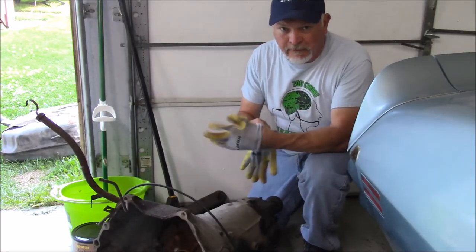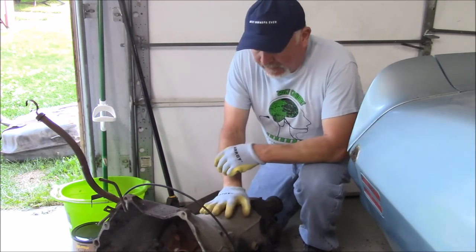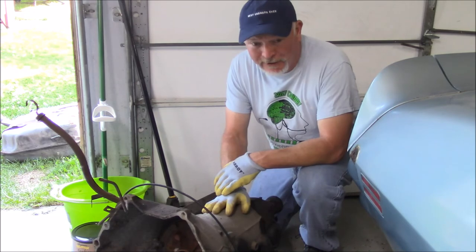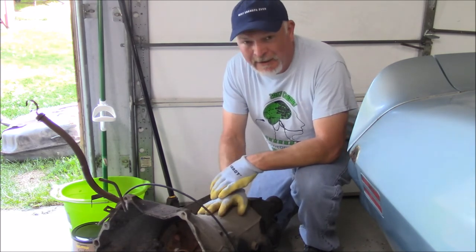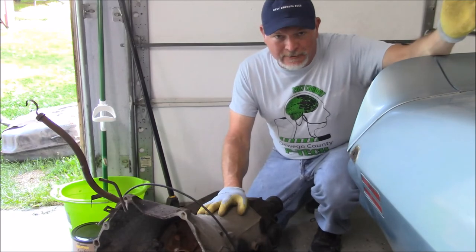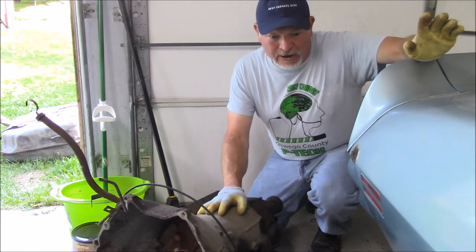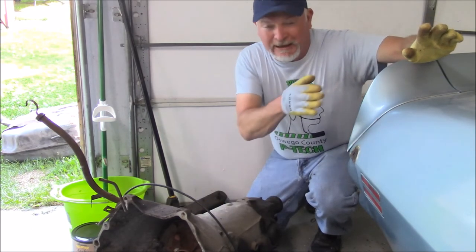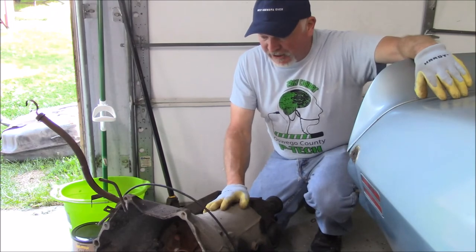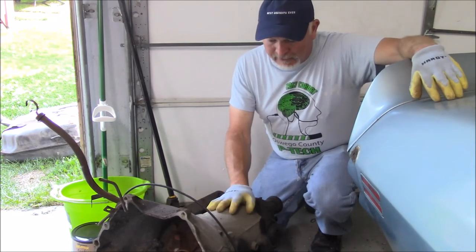I just wanted to give you a little update where we were with the transmission — we got it out of the car yesterday. My son came over and helped me; it was not a bad job. Unfortunately we did not set the camera up — it was very humid in the garage, we were just very sweaty, it was a hot mess. But we did get it out. My lift only goes up so high because this garage has restricted ceiling height. So we had to kind of wiggle the transmission and transmission jack out through the back. Fortunately, when you take the torque converter and fluid out of a Turbo Hydromatic 350, they're not very heavy.